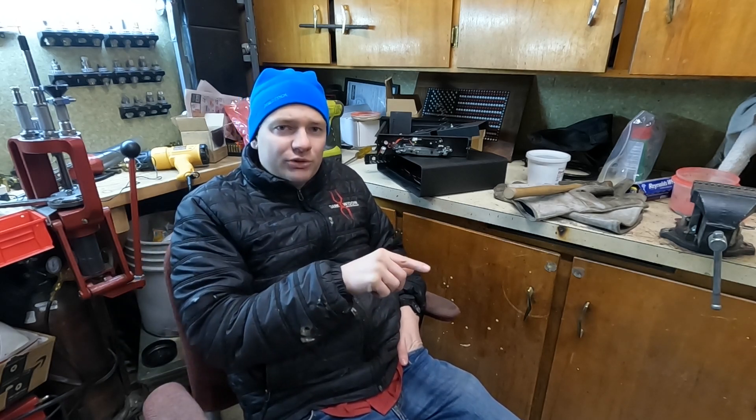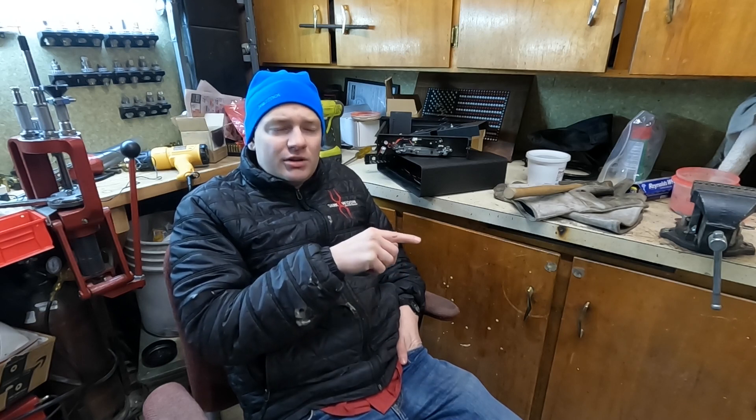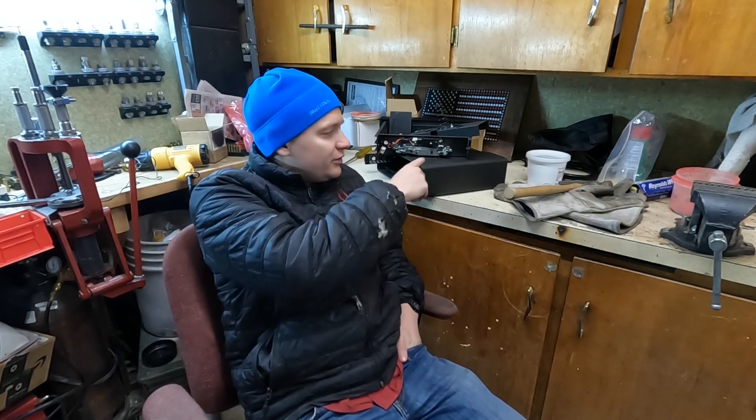It's honestly been a good safe when it worked. The other day I went to open it, the motor engaged and then just never disengaged, and I honestly don't know why. It's completely unresponsive as far as engaging the motor. Everything else works — the clock works, I can dim it, I can punch in the wrong passcode and it beeps at me, punch in the right one and it acts like it should work. I can even program new RFID tags. The five-volt rail in the back works. It's just the motor not engaging.